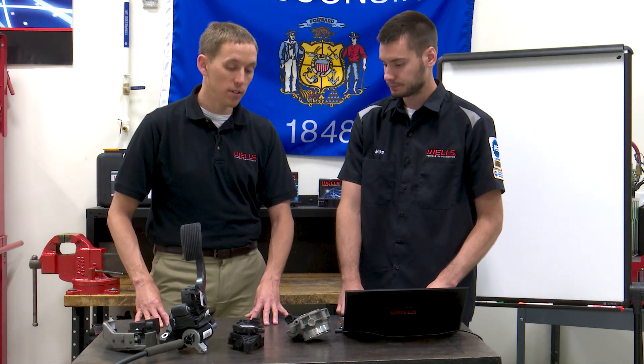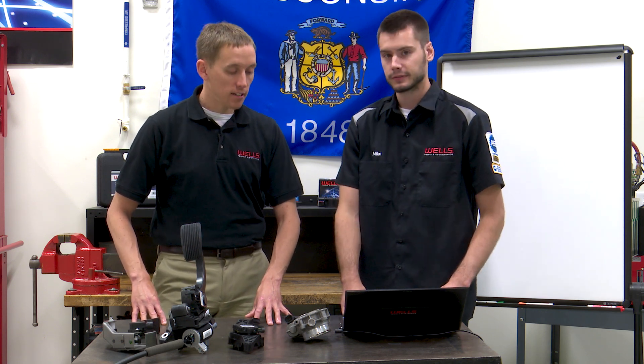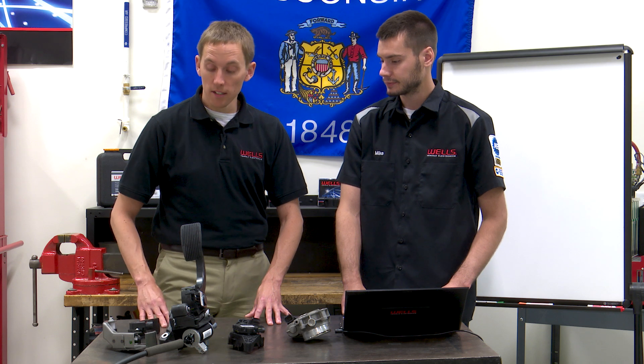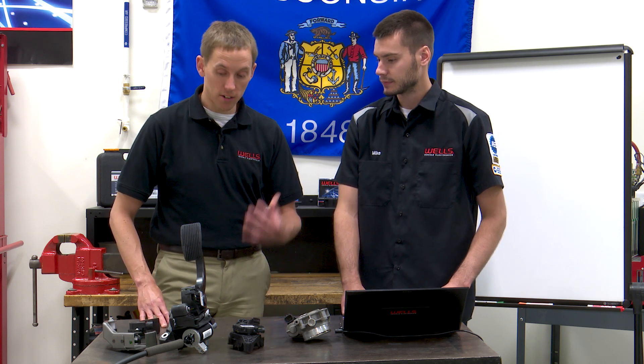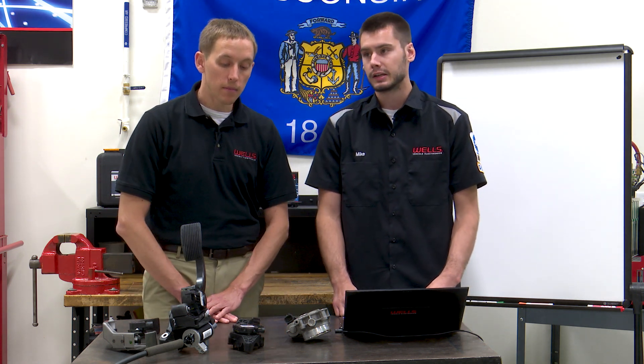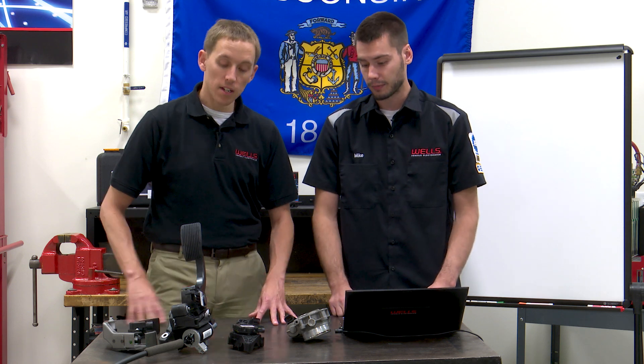You can have drivability issues. Big thing is drivability issues. You can have a depower, a check engine light. You get that little message on the dash. You may be down to like 5% power. You get that reduced power mode. Check engine light, check gauges, reduced power, limp mode. Basically you lose control of the throttle system because at that point the computer is worried there could be a runaway problem — for safety reasons.